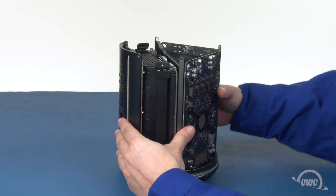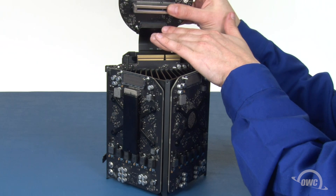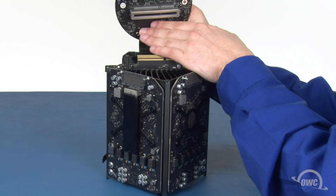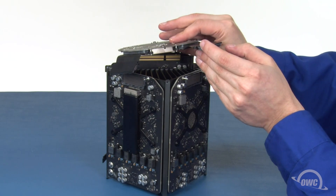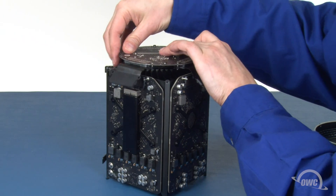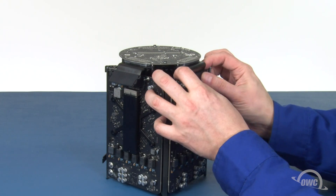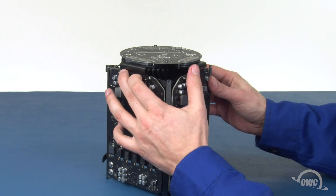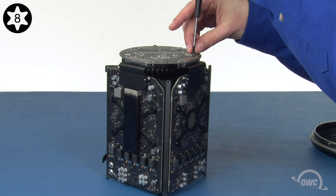You can once again remove the unit from the bottom cover and flip it over. Line the first cable connector up with its socket by making sure the two pins go through the two holes, then press the connectors together. Next, line up the slot on the bottom board with this connector and push them together until they're fully seated. Then reconnect the other two ribbon cables like you did the first one. Finally, secure the bottom board with the two Torx T8 screws.